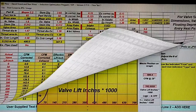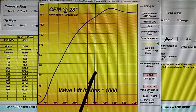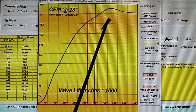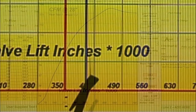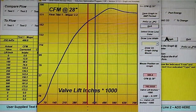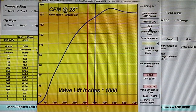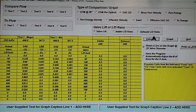Let's go and look at some graphs. Here's our intake. This blue line here is the intake valve's 0.25D lift — in other words, for a 1.6 inch valve. This is for the exhaust, but we don't have an exhaust curve on here — we're just doing the intake. That tells us quite a bit, but not as much as we might like. So let's go and look at the discharge coefficient, because that takes size out of the equation.